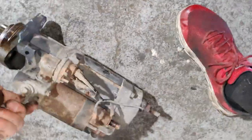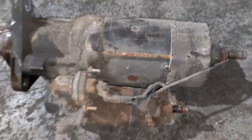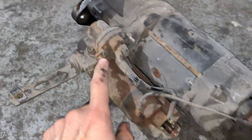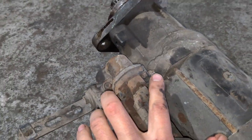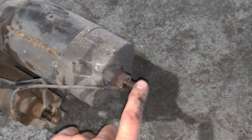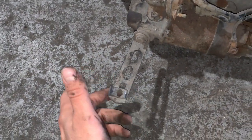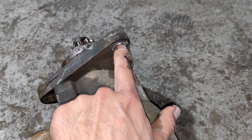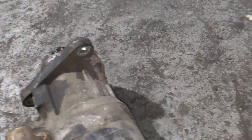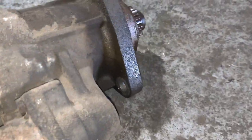This is our removed starter motor — let me show you one more time. One ignition wire goes right here, another one right here, with two 10-millimeter nuts. There is a 19-millimeter nut for the plus wires and another 19-millimeter nut for the minus. One bracket holds the wires here. Then there are three 18-millimeter nuts around the starter motor housing — one, two, and three.